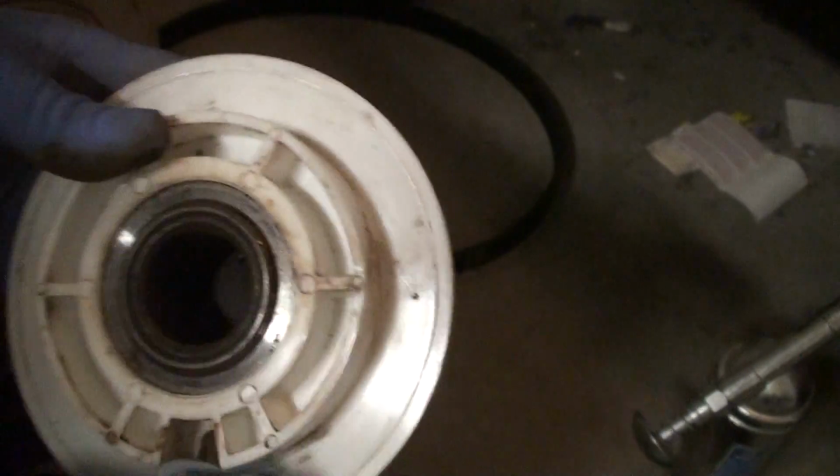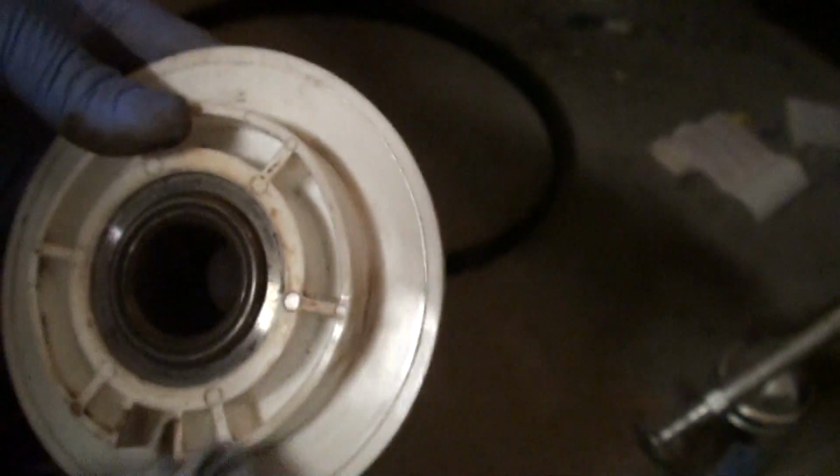Now I'm just cleaning off the parts, making them shiny again. Nothing special. You can use a strong oxidizing agent to get rid of the rusty stuff. If this is the first time for you to take this apart, chances are you're going to have white powder everywhere, which is the white lithium grease that they've packed this thing with. And it's really cheap. The last time I cleaned this out, the inside of this clutch was just full of white powder everywhere.